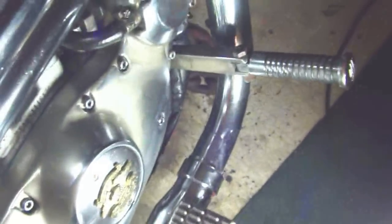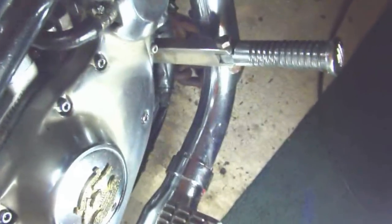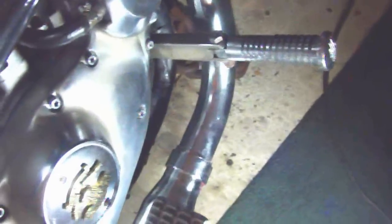And you see some of that penetrating oil I had on there, and some anti-seize that'll burn right off, so that's on there correct. So like I said, when you put these clamps on, make sure you put some grease around there. I know it'll burn off and make a little smoke, but you're not scratching that aluminum up. You don't have to put a heavy coat of grease, just a light coat, so when you get them on there, you're not scratching any aluminum up, because once it scratches, a little bit of rust starts, and then it creeps around and gets more rusty.